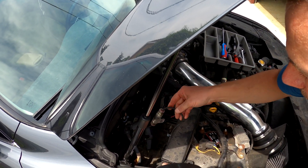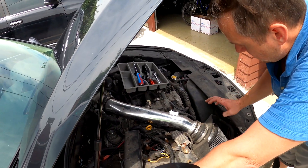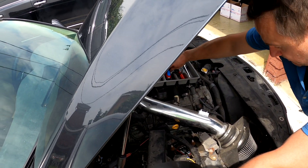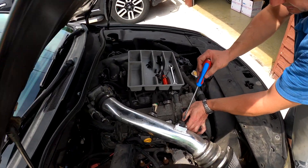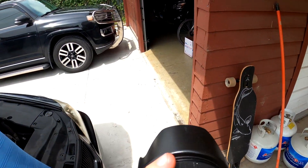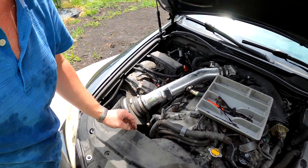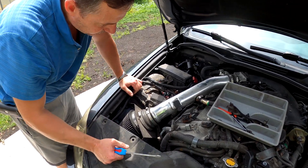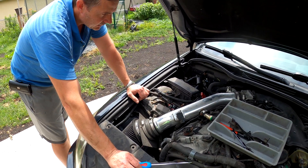You can drop this stuff in here out of the way because we're gonna be working in this area. He's got this upgraded intake — Mickey Mouse crap which some people like, but I guess it gives a little bit more power. I think this is a mass air flow sensor for the air, so disconnect that.